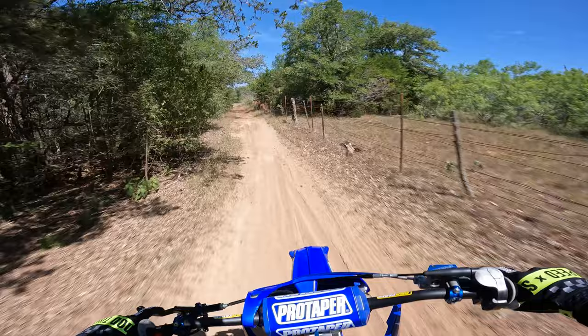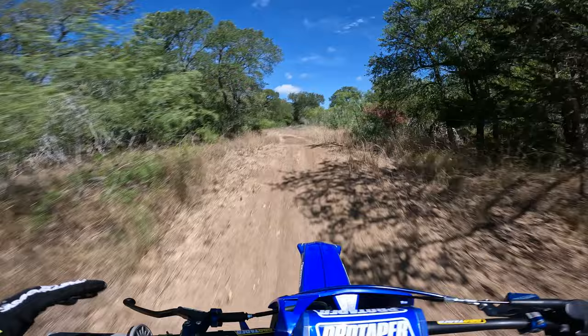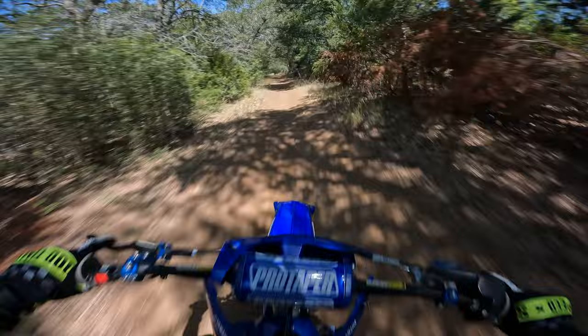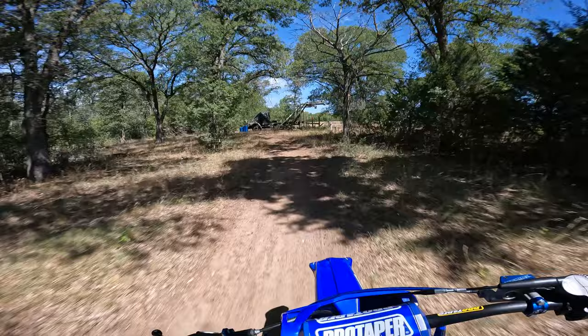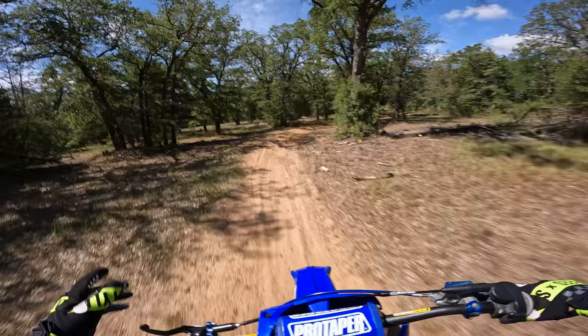On the main, you want to be careful because, oh, there is a bump. When you're wide open, you might not always be able to tell if it's running a little too lean or rich. That's why I say always make small changes and see how that reacts. Oh yeah, mains, great. It's a tiny bit richer. And again, with this hot weather, I'm still probably jetted just a tiny bit rich. But honestly, I'm totally fine with that. I'd rather be a little bit richer than a little bit leaner. Again though, it doesn't hurt to go a little lean, doesn't hurt to go a tiny bit rich. It's just the extremes on both sides that you want to avoid.